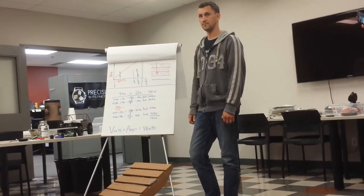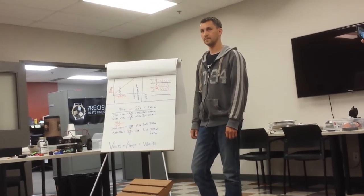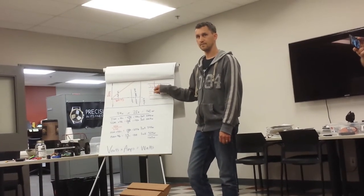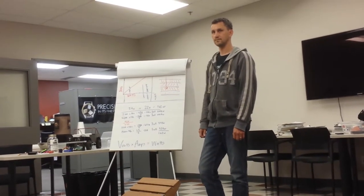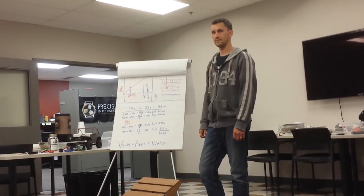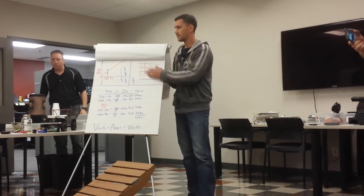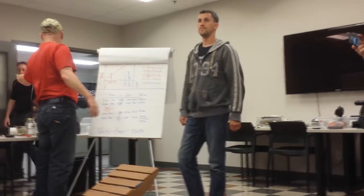Yes, because I've got three of those 7500s. And one of them is just not holding the charge for very long when I put it in the Slash. So that's the suspect one. It's not puffing. Take that one out of rotation. It's not puffed, but it's obviously showing its age. My Summit's doing the same thing. I've got two batteries, charge them up full blast, and I barely get any runtime off them, and all of a sudden it LiPo cuts off as soon as I hit the trigger. When the battery shows that it's lost capacity, you know it's done. Well, then it's going to be retired.